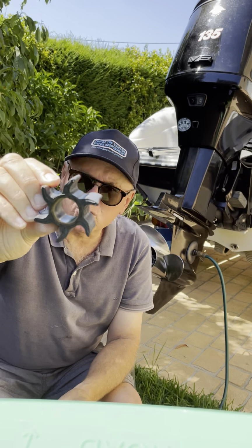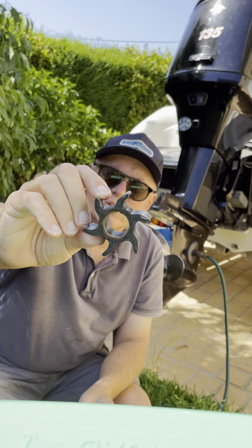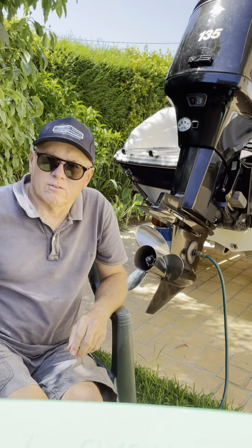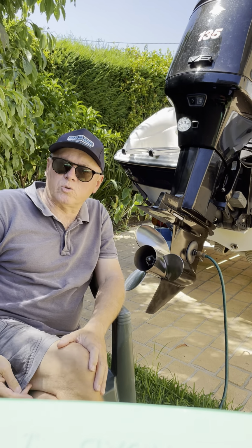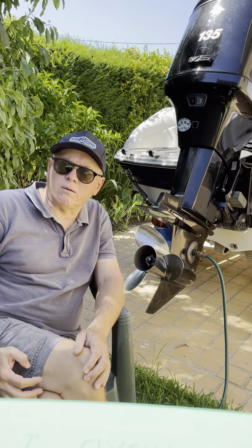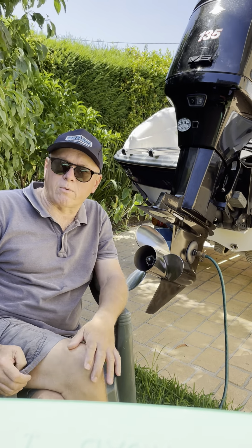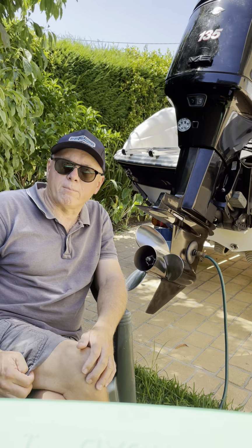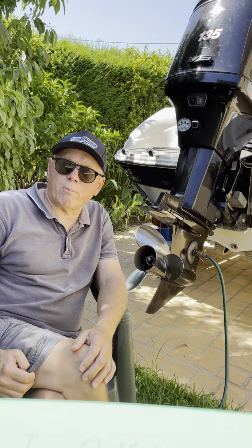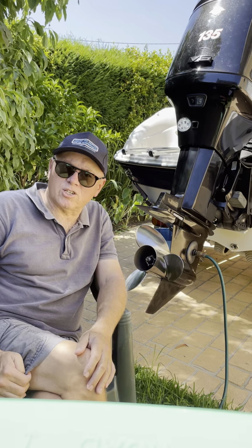And both of those two with the slope, I think they were both in service for around 3 years each. What I'd recommend is probably 3 years is the absolute maximum between impeller changes. I'd probably say 2 years is the optimum if you use your boat a lot, maybe even more frequent, but 2 years is probably the sweet spot for an impeller change. And an impeller change is not particularly hard if you're good with tools. It's something you could do yourself. It's something I do.